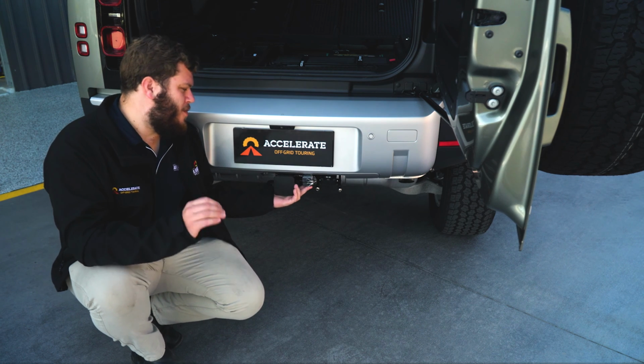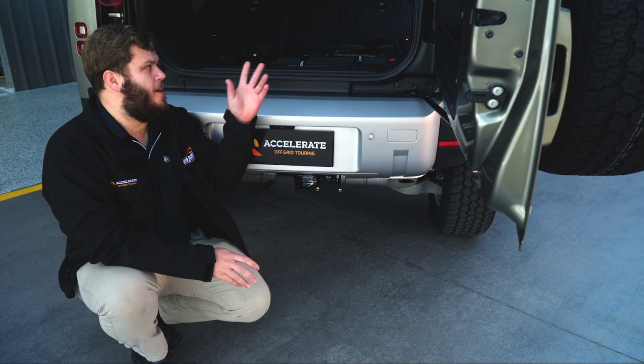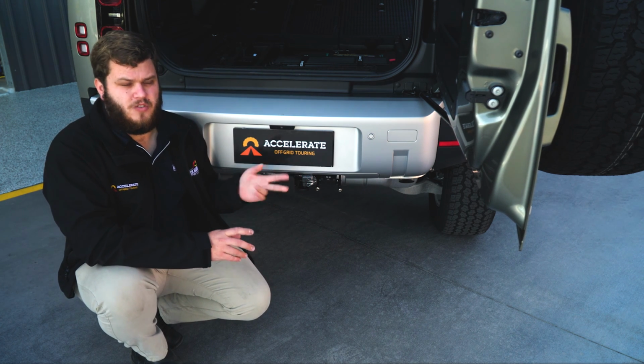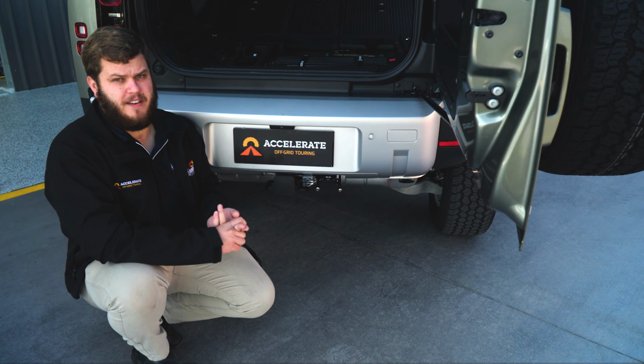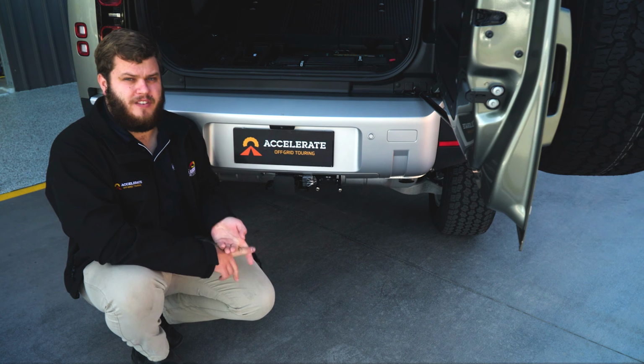Underneath, we've got the Red Anderson. So Red Andersons are typically used in a dual battery scenario for solar input. Obviously not the case for towing setups. There's normally 2 scenarios most van manufacturers require a Red Anderson plug for. One is for electronic stability control.